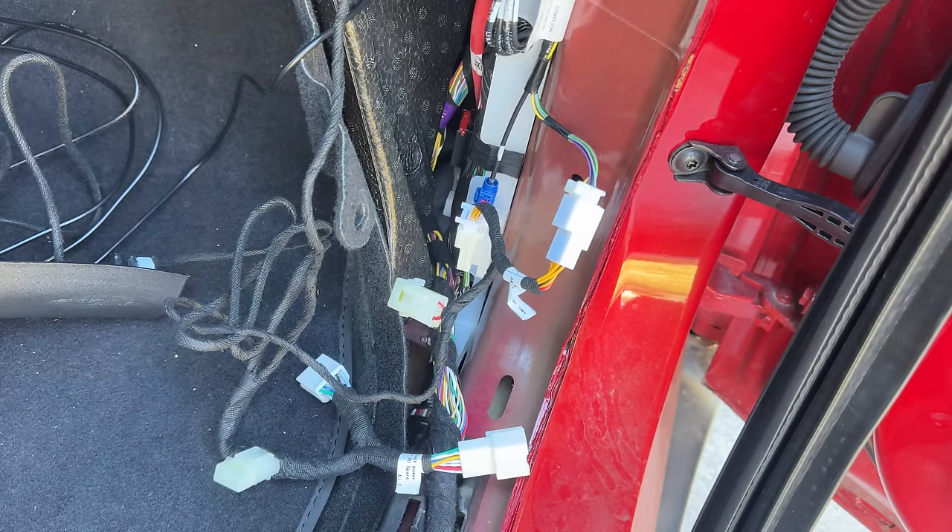I'll do the good old method of securing this with electrical tape and pulling it from the other side. I ended up just passing this through here, and because this is super thin it actually seals really well and doesn't stick out. The firewall seals. I know this is not the preferred method — you should probably make a proper hole if you're absolutely concerned about safety — but the firewall seals in my opinion and I'm going to leave it like that. I like non-invasive installation so rather than making another hole, I'll leave it as is.